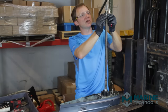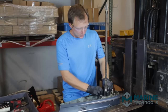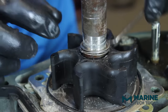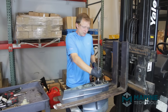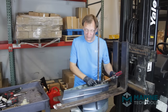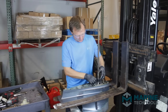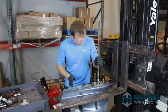These driveshaft collar assemblies really like to stick together and make life difficult, but it's fast with the puller. Now we have a wave washer assembly — three pieces: two flat washers and a wave washer in the middle. Set those aside because they go back in with the new impeller; they do not come with the water pump repair kit. Pulling the impeller off usually requires a little prying. Try to use one of the dowel pins as the fulcrum so you're prying on something you won't damage. On Yamahas they usually come loose pretty easily.